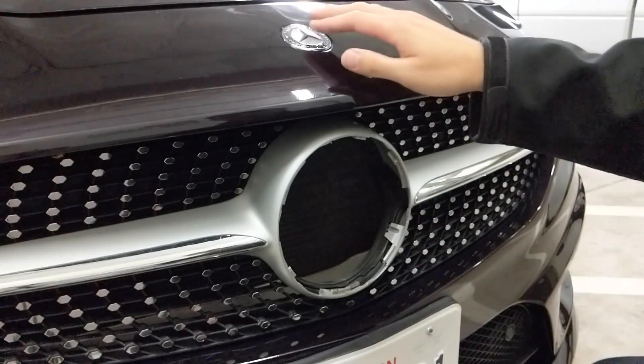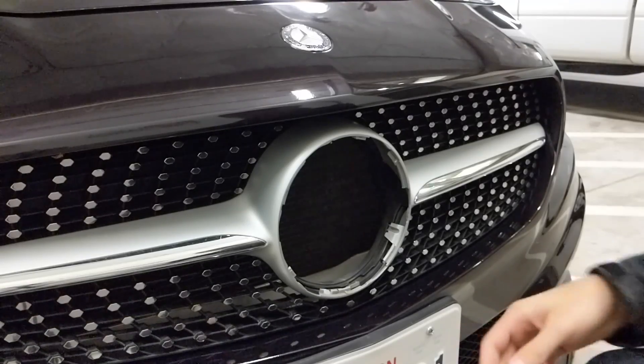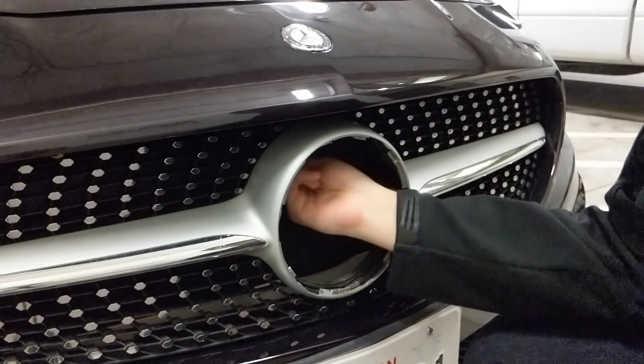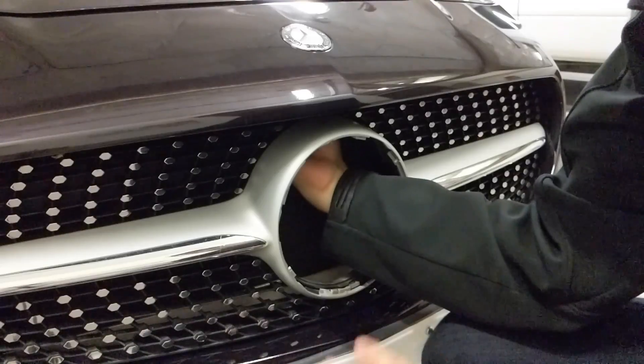Here's the tougher part. Unlike most Mercedes, the hood emblem is not actually on the hood, so you don't need to release the hood to remove it. I've grabbed just a regular household key. The emblem is up underneath here — I'll show some pictures overlaid — but basically there are just two prongs that you need to push on.